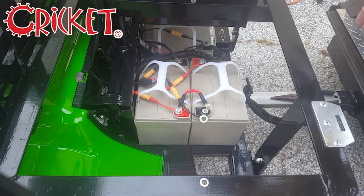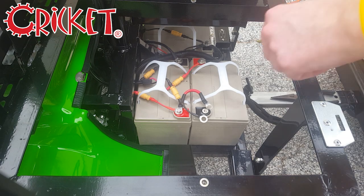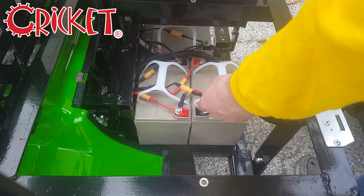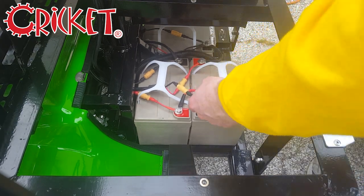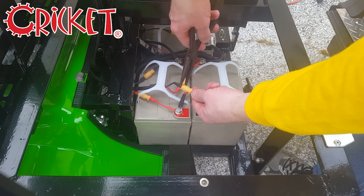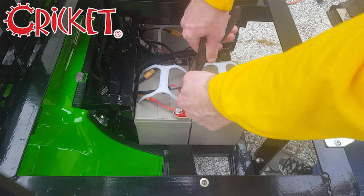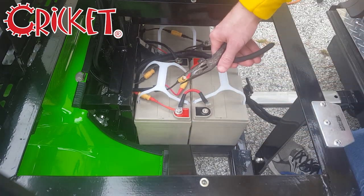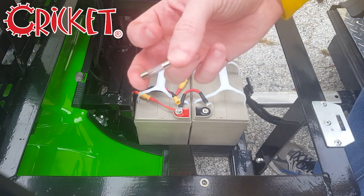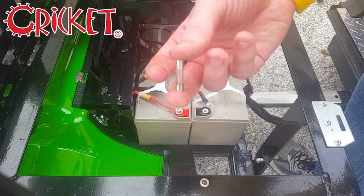If this is the case, remove the bad wires from the battery. The fuses are located here above the wire. Using a pair of pliers or other tool to hold it in place, pull out carefully so as not to shatter the fuse. Inside you'll find a glass 30-amp fuse. We sell these on our website and they're easy to replace — just pull out the bad fuse and slide in the new one.